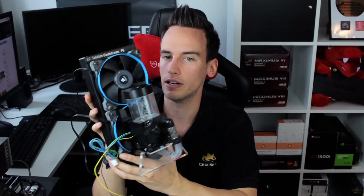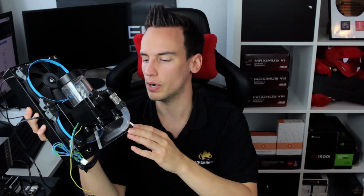I'm really looking forward to seeing the actual difference in VRM temperature. It's also the first time I'm doing this kind of VRM test using a monoblock. As a water cooler I will use this combination I always use for cooling testing: a 240 radiator with Corsair fans. It's not the biggest radiator but it's convenient — I have the EK DDC pump-reservoir combination mounted directly in front of it with an acrylic extension so I can put it right on my table.